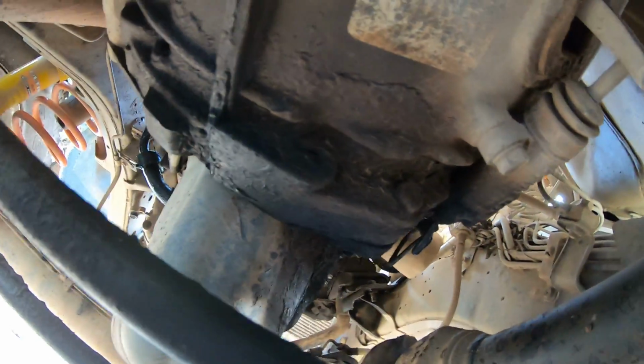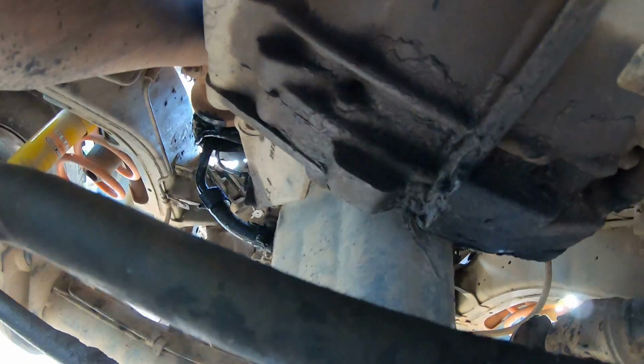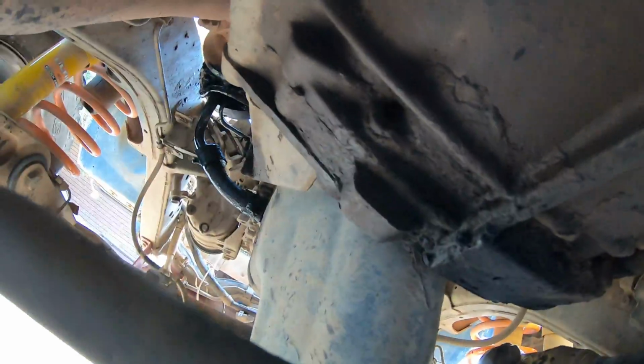All right, you can see from my oil leak here, this is our bell housing bolts. So we got one here, the other one's up here. We got the other starter motor bolt up there, right there. And I'm just going to take these little inspection panels off. I think they're called ears. To do that, and you can see our dump pipe bolts, just at the tip of my finger up there. And for some reason, I think one of the nuts has wound off, so there's only 2. So we'll hit them, and then we should be able to try and get this engine out now. So let's do that.